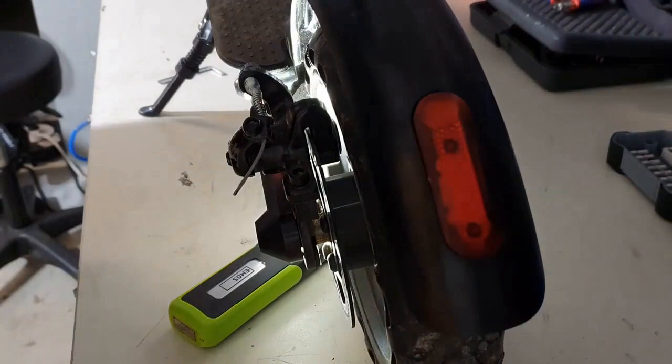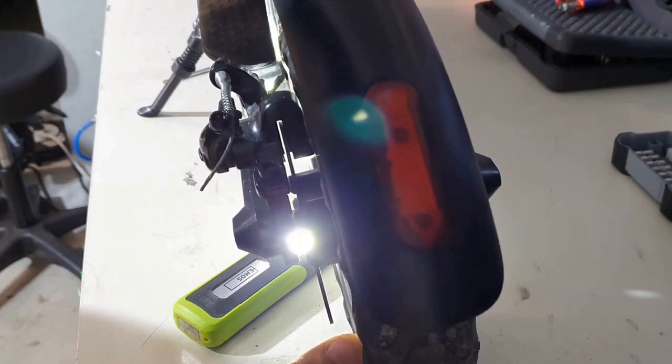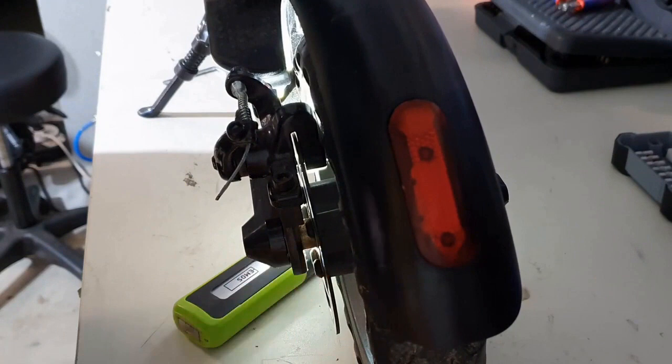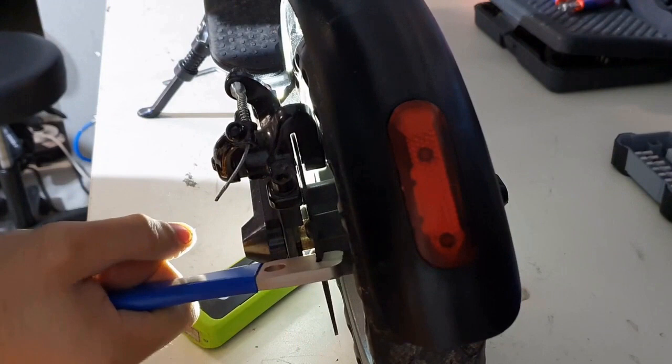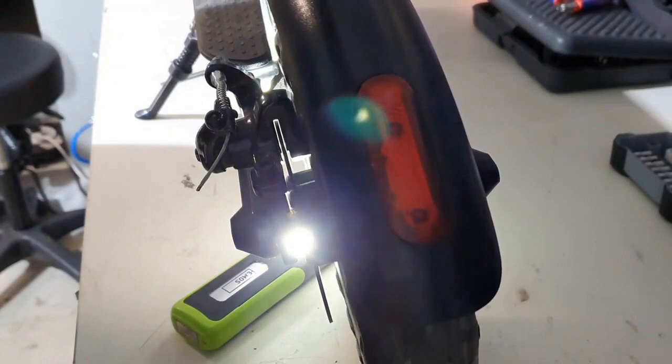We have a tool here to align the brake discs. Currently, we are driving back to the spot, the specific area where the brake disc is making contact and experiencing friction, causing it to rub. So that would be the case here, without any doubt. Position our straightening tool on it and proceed to bend it. Gently slide outwards just a little bit here. Already much better. It still touches very lightly. We'll take care of that too.